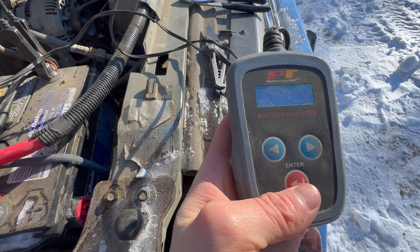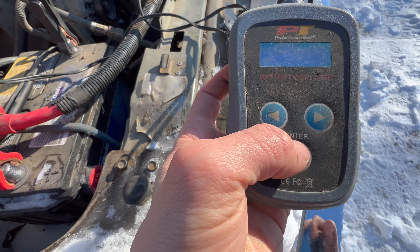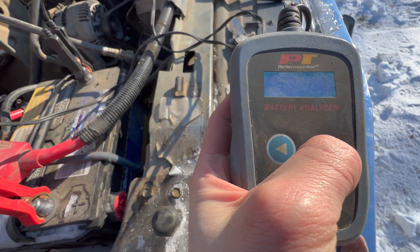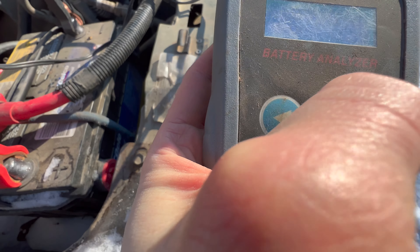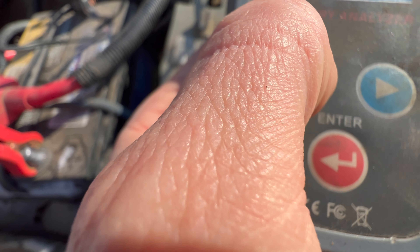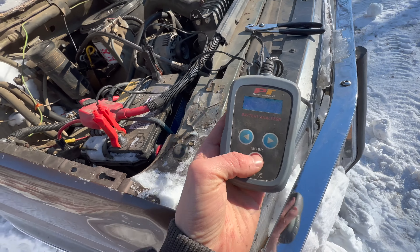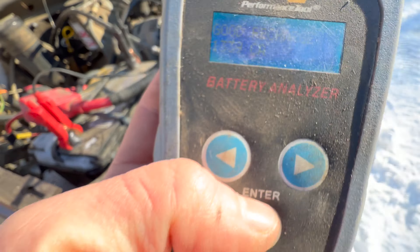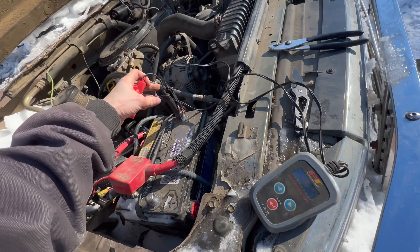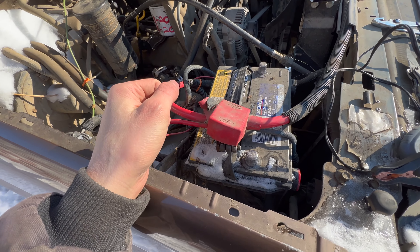Okay, I decided to test the battery — it's at 12.1 volts. Yeah, she's pretty weak. Cranking amps is 800 cold cranking amps. It's testing good — recharge is 1,339 cranking amps. Okay, that one tests good, still got to clean the battery ends. On the other side I'll test that one — that one's good.